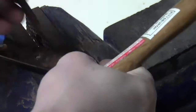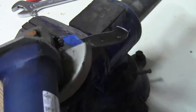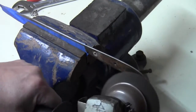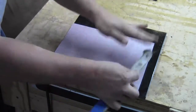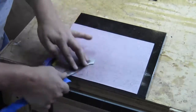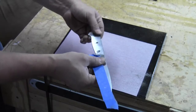A punch removes the other half of the rivet. I'm using a wire brush here to clean up all the surface rust. And I've got some 150 grit sandpaper — I'm trying to create a crosshatch pattern just to have some abrasions on the metal. Hopefully that will help the epoxy bind to the metal a little bit better.